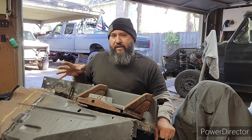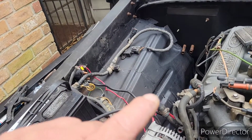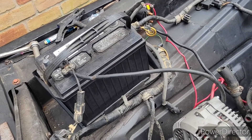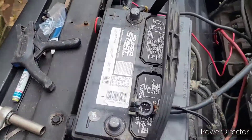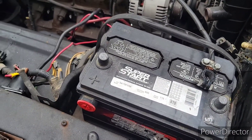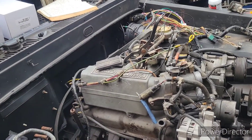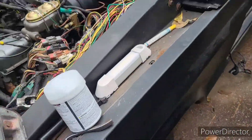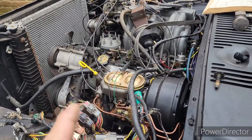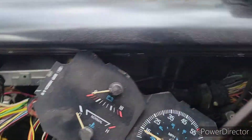I'm going to chop off the top because it's a little too tall for the fender side, and re-drill so it bolts on from the plastic down to stay put on the fender. Here it is already installed - by no means professional work, but it'll get the job done. This is a work truck. Now I'm messing around with the instrument cluster, and the Chilton manual is no help. All the wiring is from an '88 F-250, so I'm having to get back into the wiring.